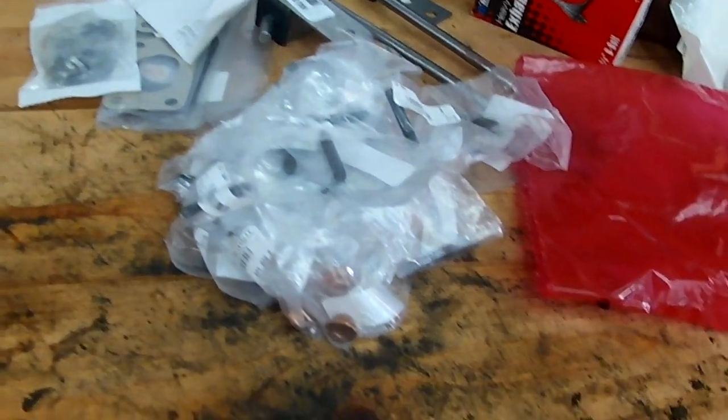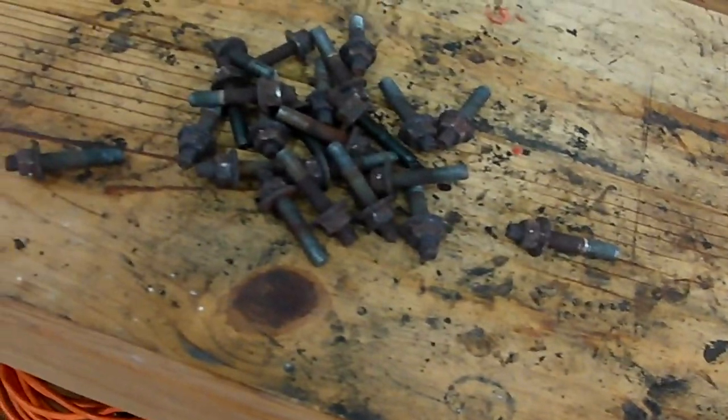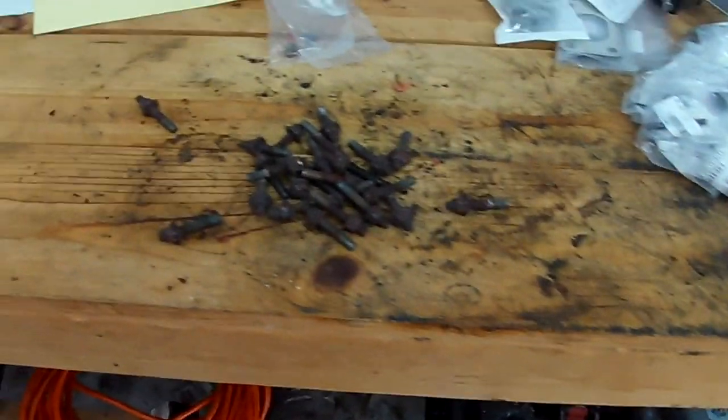So that way you just double nut them in. You don't have to worry about compromising the flanges on the copper nuts. Because obviously I was not able to get any old ones off the existing studs. So what I did was just wiped off the surface with some brake cleaner. I'm just going to go now and just install all 24 studs. Take forever, but should be done. Then I can finally get the new headers on.